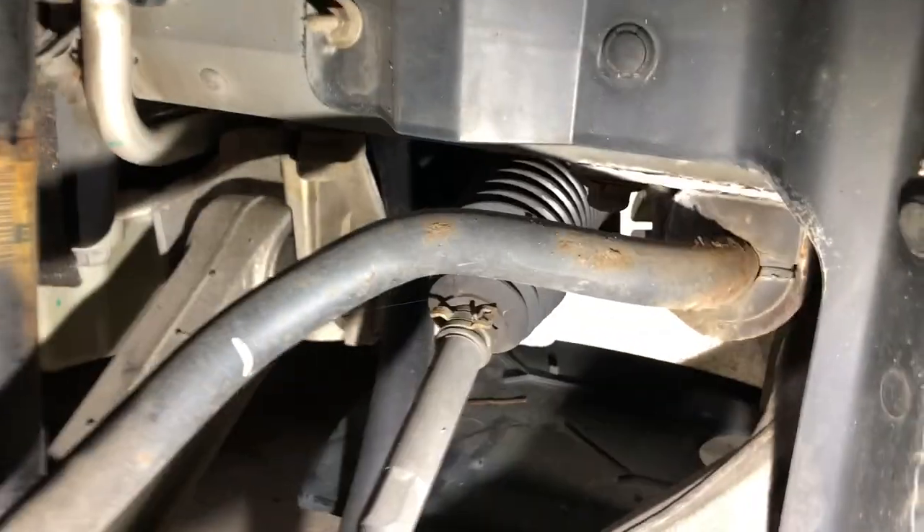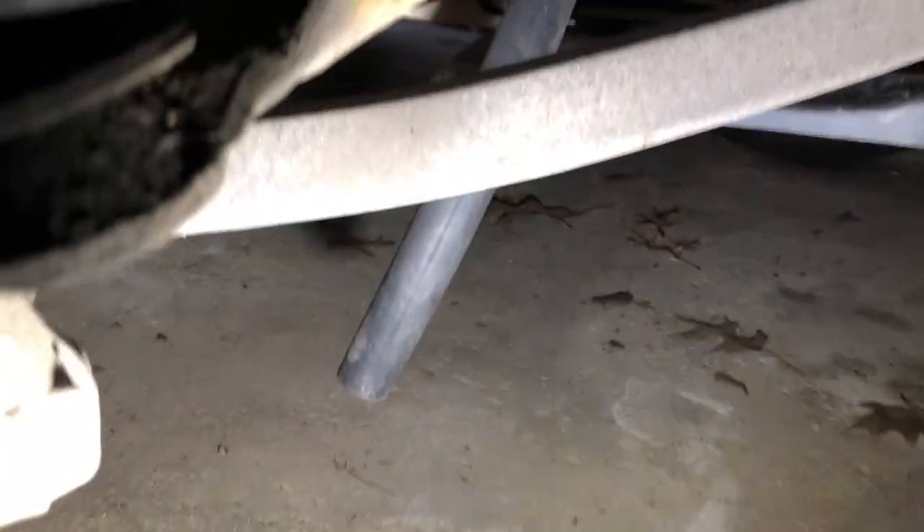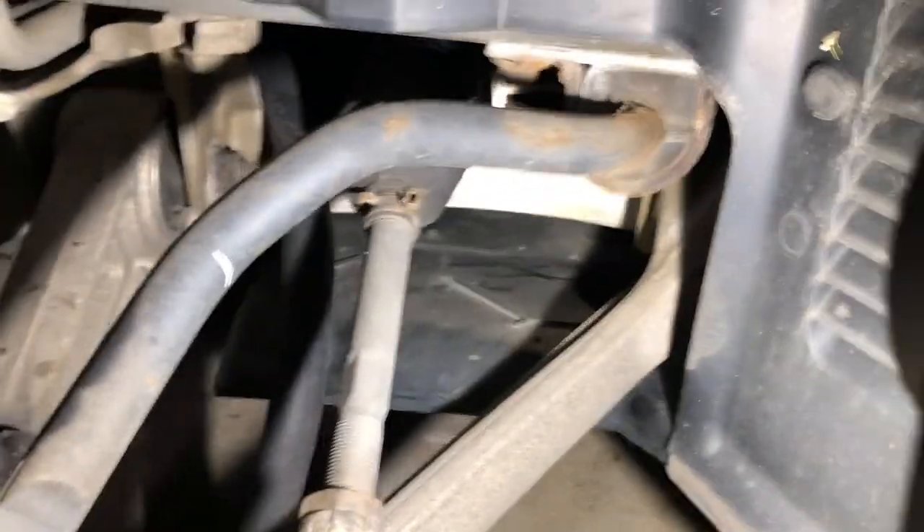I removed the wheel to see where the hose is coming out. I had thought about running it through the smaller hole, but that would have put it right in the gap where the bolt is — meaning anytime the battery pack was moved, the line would get tangled up. So I moved it to the larger gap. It's coming out here now and it's a little long, so I'm going to cut it. I'm going to drill two small holes in the shroud and zip tie it right here, cutting it off even with the edge — it'll be out of the way of everything, with no clearance issues, and that'll keep it located outside the shroud.